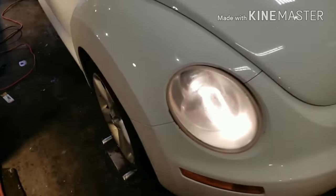With that disconnected, the motor can actually rock. That's me being able to rock this motor back and forth. When we let it down and rock it back, we'll have full access to the intake manifold — extra space to get it off. Now we have the torque strut loose at the bottom. We'll take the tubing off and that'll give us access. We'll disconnect all of our wiring harnesses, which disconnects your fuel injectors. You'll want to remove your throttle body, but before you remove the four T30 star bolts, you'll want to remove the vacuum hose and the wire connectors.